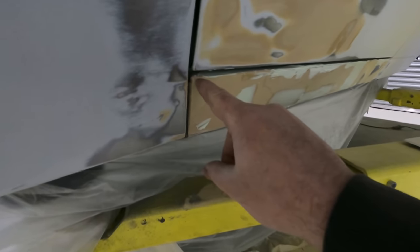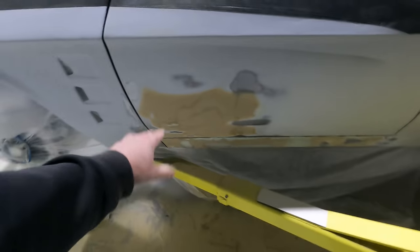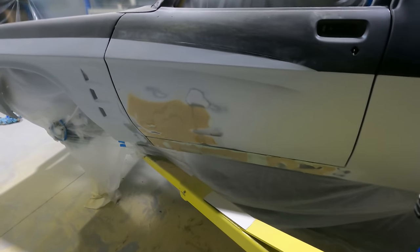Just leveling up - this area here was only out in this corner by about four mil so I've just built formula bog up along there. It's not the best way to do it, it would have been better to cut the metal and bring it out, but the bog way is easy and it's down the bottom - sun's not going to get to it or anything, so it's never going to have any dramas. It's not in a high chip area either.